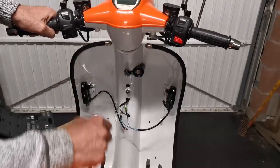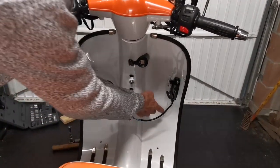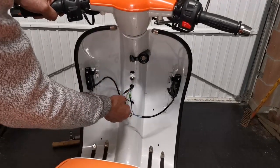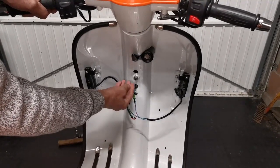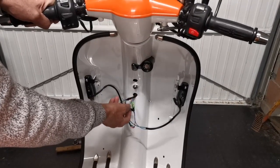You can see I've already taken the glove box off. This is fairly straightforward — inside your glove box you'll find there are four chrome domed nuts which you undo, and that brings it forward. You then disconnect your speedometer button and the USB port. So they come off fairly straightforward.